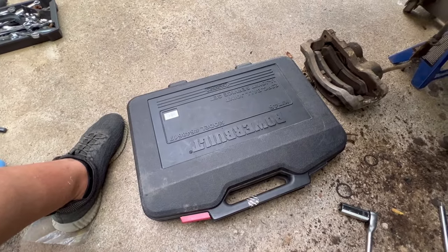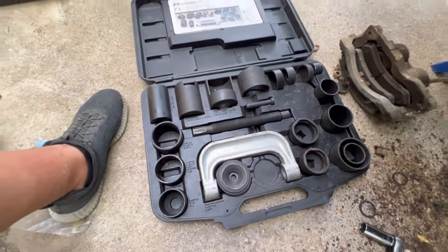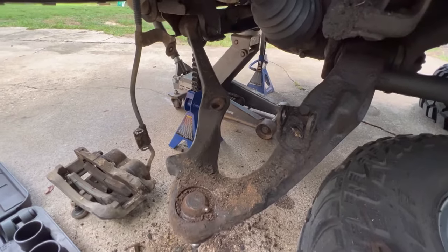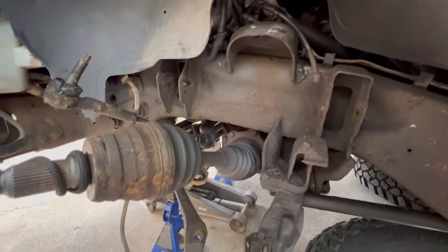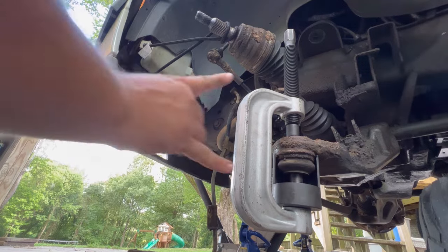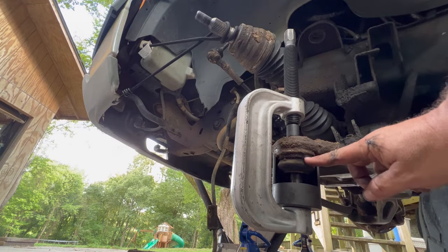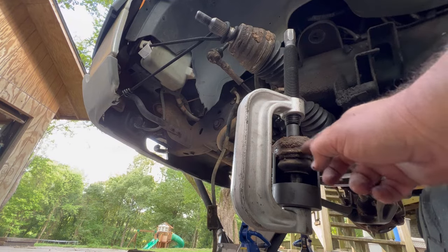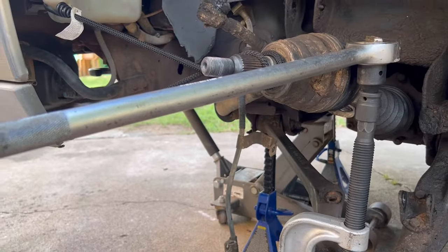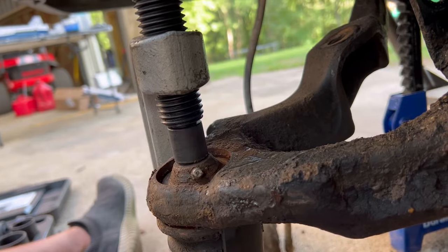This kit is compliments of Advance Auto — thank you, Advance Auto, for having this available to rent. It's a tool for removing ball joints. Because if you try to buy this lower control arm, it's going to set you back way north of $100 a piece. While the upper control arms are cheap enough to just replace the whole thing, these lowers we're going to press out. I've got this tool set up — basically you have a giant C-clamp. You find the collar that fits around the outside edge of the ball joint, and then you put the threaded side on the top because they press in from the bottom. I've got the cheater bar out — three-quarter stepping down to a half on a 7/8 — and let's put some hurt on this thing.